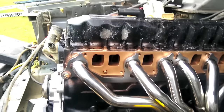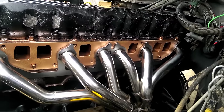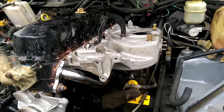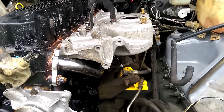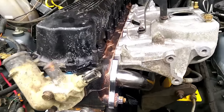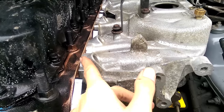The exhaust manifold is on — I could reuse my old washer and nut from the old Renix head. Now you just put the intake on and it bolts right up, right? That looks good, doesn't it? Nope. It's got some dowel pins in there to hold it in place, which is nice. You notice the top looks nice and flush — but it ain't level.